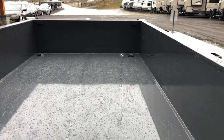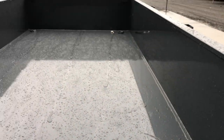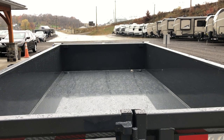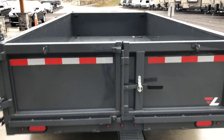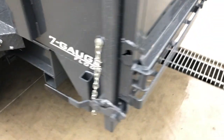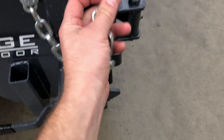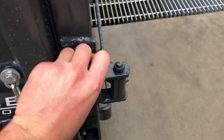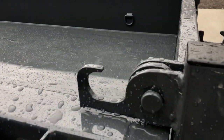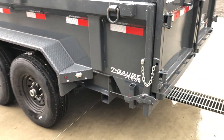The D-rings are kept up off the floor, which is nice. The front ones are down low — that's designed so that stuff doesn't get hung up at the rear of the trailer. It's about 83 inches wall to wall; everybody calls them seven-foot dumps but you're generally going to get about an inch or two less than that. Two-way gate at the rear — you can open it up like a barn door using your hook style to swing it open, or you can use the spreader feature. Simply set your depth and go.